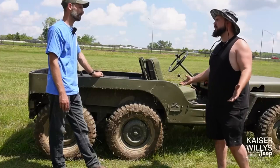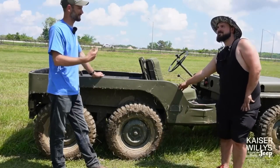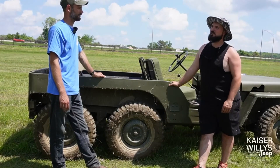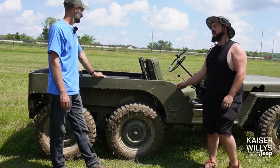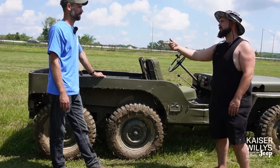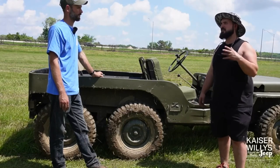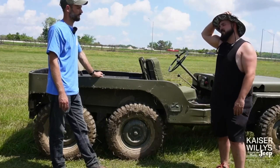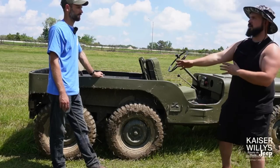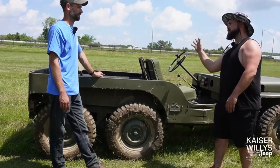Having done all this work and driven it, if you could do anything differently, what would you do? Honestly, it's not that I wouldn't do it again — it's that the transfer case stressed me out for like a year. I had the frame done, the suspension done, everything done. The only thing I couldn't figure out was the transfer case. I took it to one machine shop, had it there for about six months — they couldn't do it and kicked me down the road. If I were to do it again I'd probably do the SCS drop box, or stretch it out maybe another foot and a half to two feet and do an NP205 doubler, reverse-flipped.